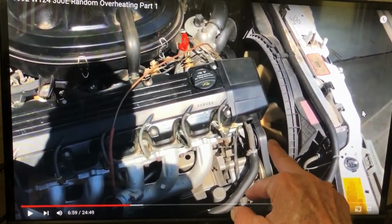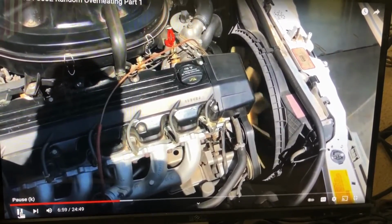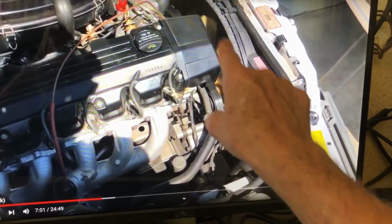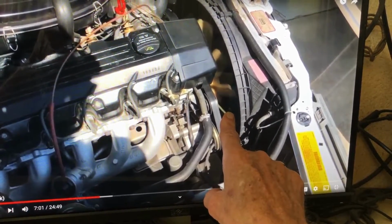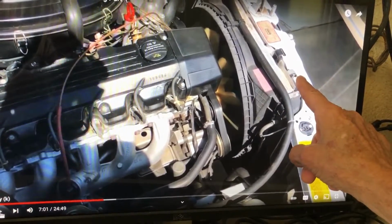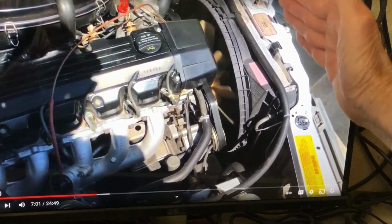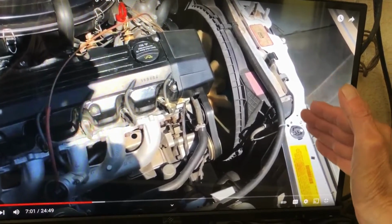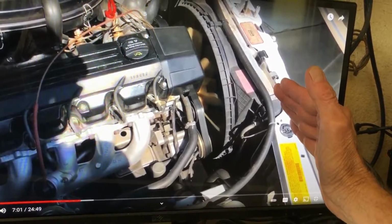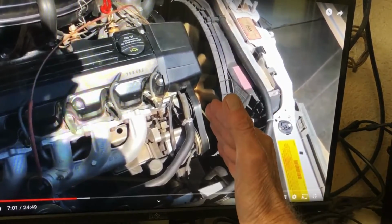There's a clutch fan here, where this fan is, right? See this? See that thing turning? This is the main cooling fan for the engine when it senses that it's overheating. These auxiliary fans, when they kick on, they do help, but not that much, because you've got auxiliary fans in the front, an air conditioning condenser behind them, then the radiator, and then the main cooling fan.